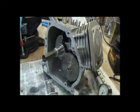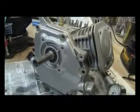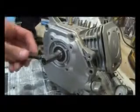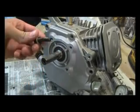Make sure the dots on the camshaft and the crankshaft are properly lined up. Be sure to check the clearance between the crankcase and the cam lobes — the clearance should be at least two thousandths of an inch. Next, install the gasket and studs, then place the cover on. Be sure to oil the bolts and thread them in by hand before torquing them to 17 foot-pounds in a criss-cross pattern.